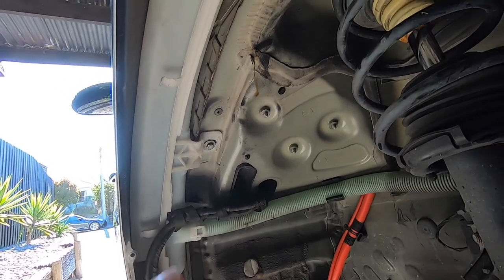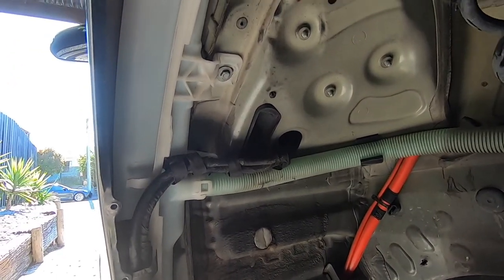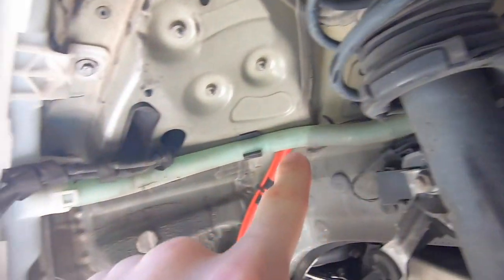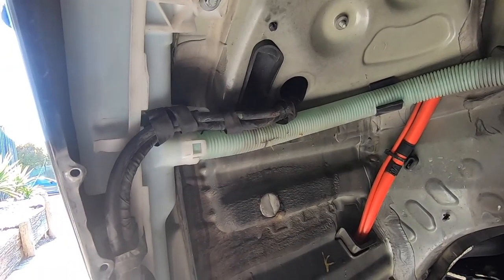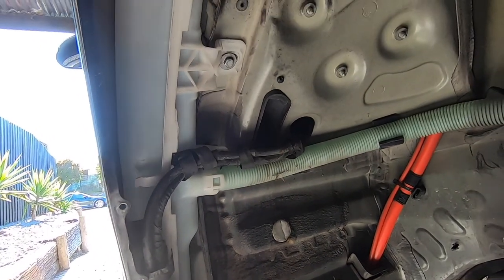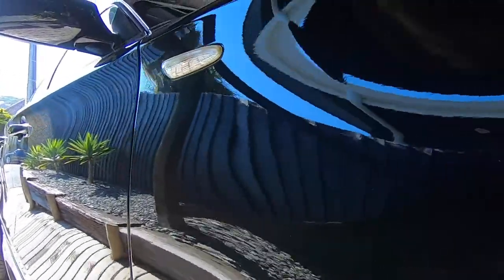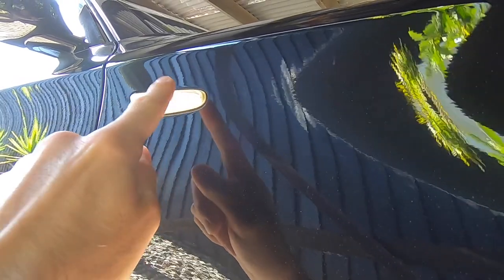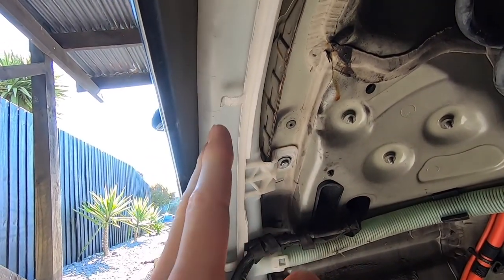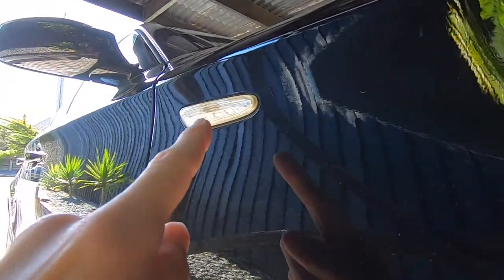It can be quite tricky to remove — you do need to tease it out in a few awkward positions, but it's not that big of a deal. Holding it in is a 10mm fastener that needs removing, then there's the tube that goes to the filler neck up inside the engine bay — that just unclips, let the fluid drain out. Before we get too carried away, we want to remove the side indicator here, because it sits inside the wheel arch and will catch on the reservoir, making it very awkward to remove.